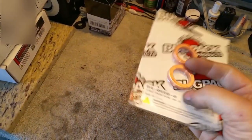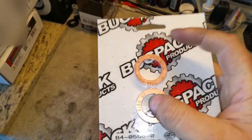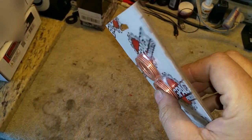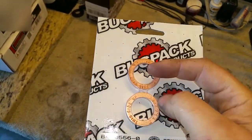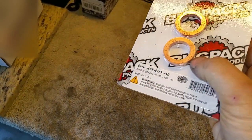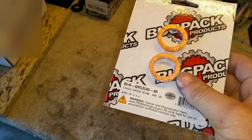So anyways, I want to do this right now before I break the engine, because I really want to rev the you know what out of it, but I'm just afraid to do so. So I just keep it under 5,000 RPMs because I just don't want to break it. You know what I mean? So we're going to go ahead and add that shim on the valve spring on cylinder number 4, and that would be the intake. So I'm going to get my doodads.